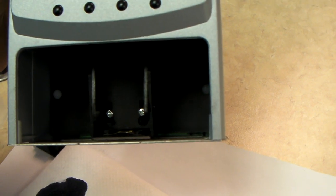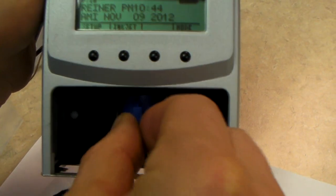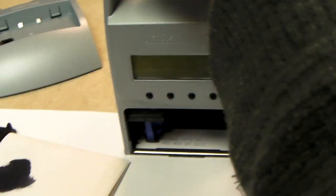Then press mode again. Press the word inkjet. Brings the holding cradle over to the center of the unit. Slide the cartridge in. Pull the 2 little handles down. Press inkjet once again. And now you are ready to make imprints by squeezing the button underneath the handle. You'll notice that it'll print neatly there.